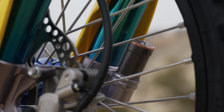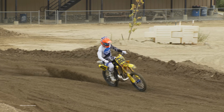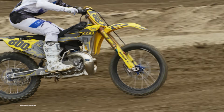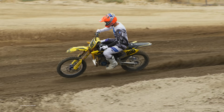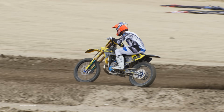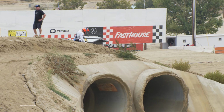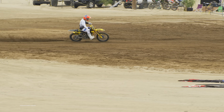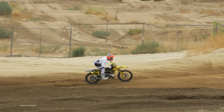Beyond the suspension, we love the precise feel of the oversized Honda CRF front brake. Yes, you heard that right. Mike switched out his Yamaha's Nissin master cylinder for the 2005 Honda CRF450 version. He upgraded the stock 270mm front brake rotor to a 280mm Moto Stuff rotor and used an Arc lever. Mike was quiet about his front brake, waiting to see if MXA would notice his little secret.